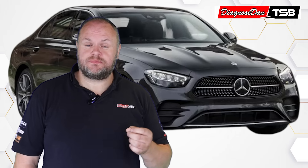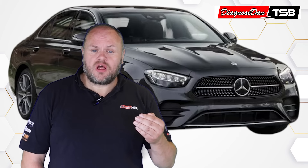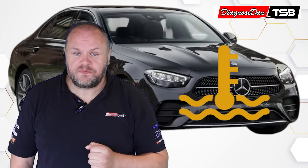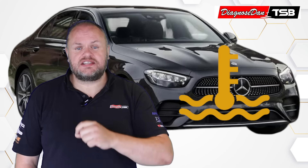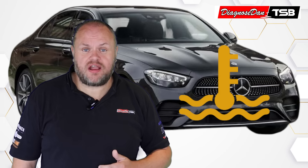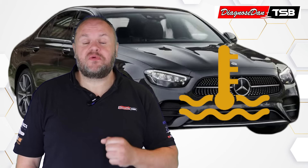The owner of a 2021 Mercedes-Benz E-Class hybrid called Laurits' shop and told him he had a coolant low warning on the instrument panel. Laurits advised him not to drive the vehicle and drove out to the customer's house. When he got there, indeed, the coolant level was low — just a little low, but just enough to trip the sensor. He topped up the coolant and started the vehicle, but the warning was still there. And that was the moment Laurits realized something wasn't right.